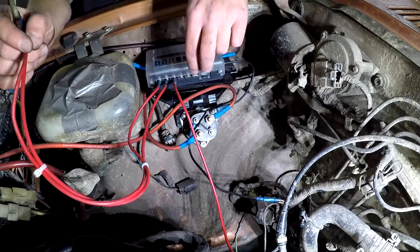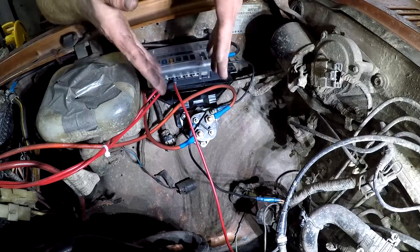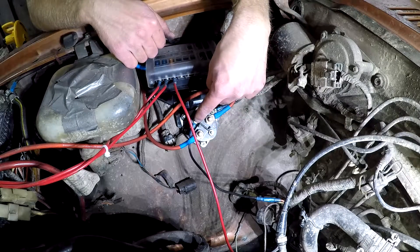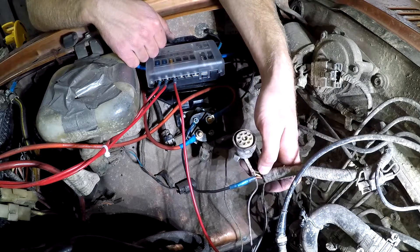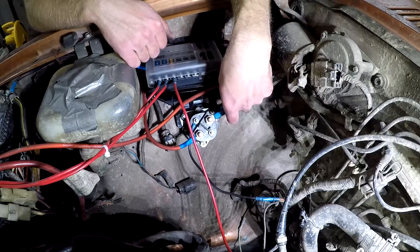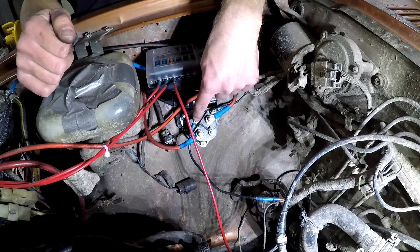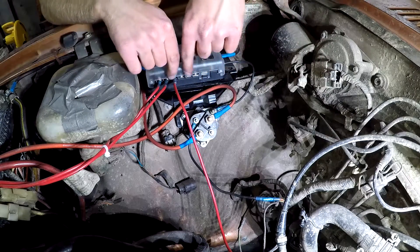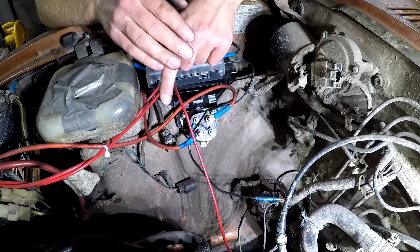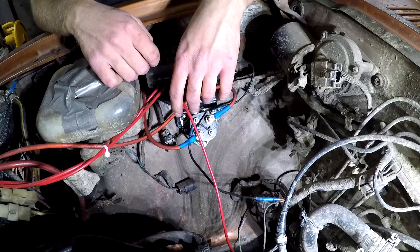If you haven't seen the fender fuse block video, go check that out — link in the description. I wired the alternator signal into the fender fuse block, but had a small problem because the fender fuse block is always hot, wired straight to the battery. So I took an old truck solenoid and found key-on 12 volts coming from the old six-pin output plug on the factory fuel injection. I ran 12 volts key-on to the switch post on the solenoid, wired the battery to the always-hot side, and wired the fuse block into the switched side. That causes the entire fender fuse block to kick on and off with the key, which is important — because if you don't do that or fix the factory wiring, the rectifier in the alternator will never turn off and you'll get a battery drain. This is also giving my choke heater 12 volts key-on, which is good because that can also cause a battery drain.